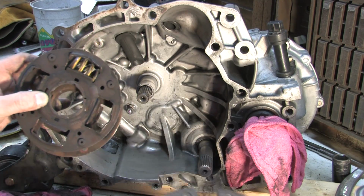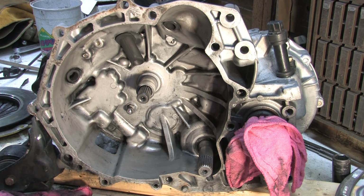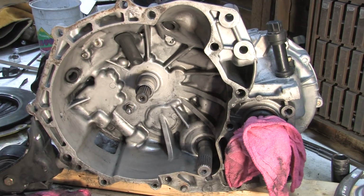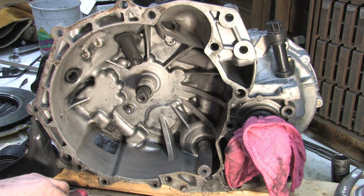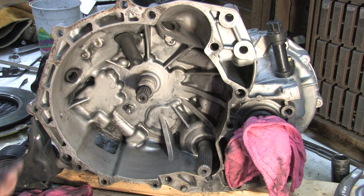Now, there are clutch plates that don't have these springs in them. A lot of people have problems with the springs failing and firing out and bouncing around the transmission, tearing up their flywheel and destroying things. And there's been a rash of that in just about every brand of clutch. At some point, when you start making enough power, parts fail. So there's no real fail-safe clutch to buy, in my opinion. I think there are some that are better than others, but you put them in our hands. Look at my hands, and look what I managed to do to it.